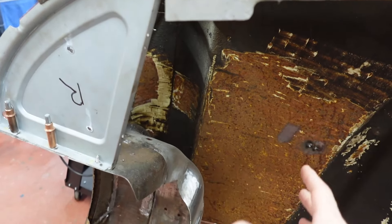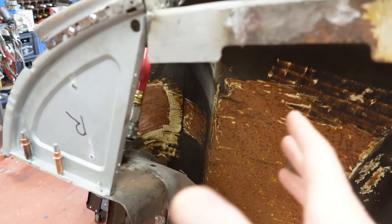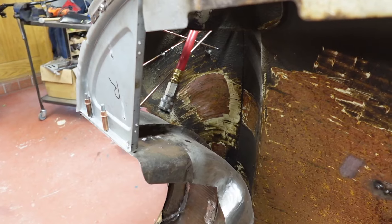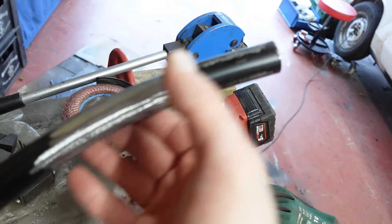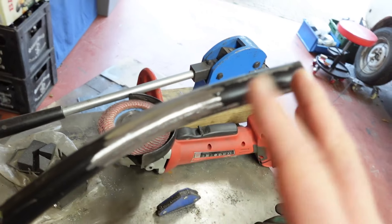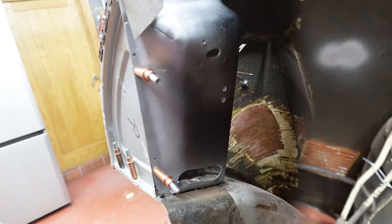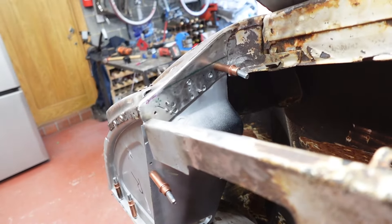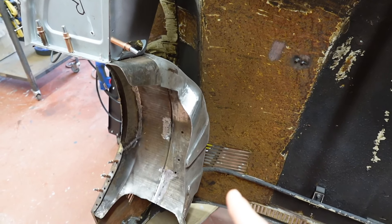If I take one piece out, the rigidity of everything else will stay. Put that piece back in, and I can move other stuff without risking distorting what I've put together here. You're also seeing how I've welded this up — you can see a kink in this, maybe I'll do something else later. I'll get all that, it's got a bit of primer on and up under there and clamped back in. Now I'm going to pull the wheel arch out, get that cleaned up and primed where it needs it, and then we'll be ready to start welding this stuff. That's the wheel arch out — mostly cleaned up. I've given a blast to some of the edges, particularly that seam, which wants to be nice and clean right now, and the bits that are going to be awkward to get to later.